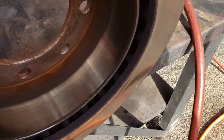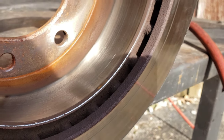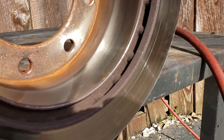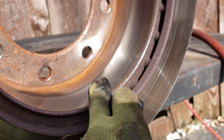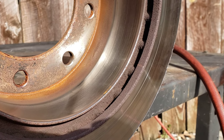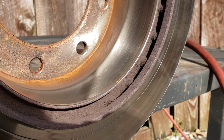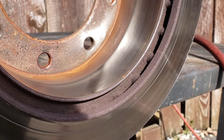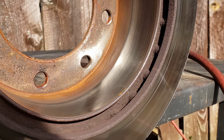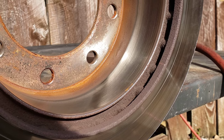Here is the thought process behind what I'm about to do. When you go and buy an aftermarket drum and hat from, say, Advance Auto Parts or any chain store, the drum — which is where your parking brake rides — is smooth. According to various resources and some research, I found that if you buy these from Ford directly, these drums come bead blasted — texturized just a little bit — and you break them in during a procedure described in the Ford service manual. So what I'm going to do is roughen the drum surface up a little bit.